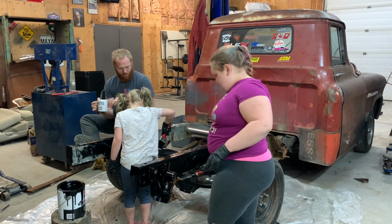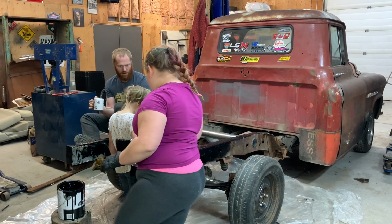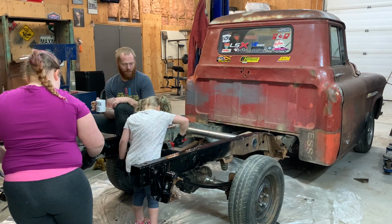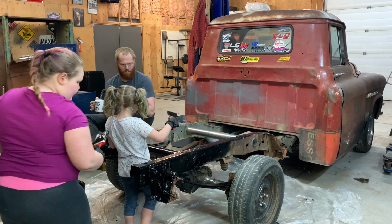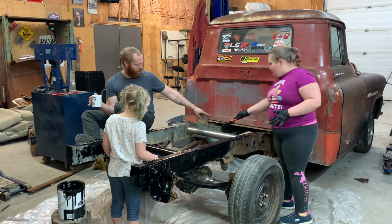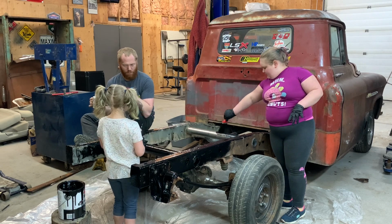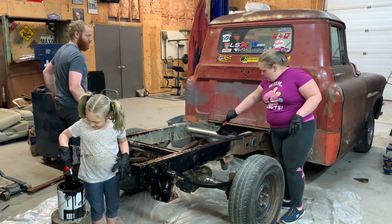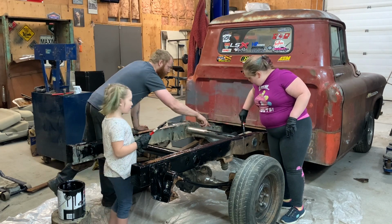This is looking so cool. I'm probably going to have to do another coat on this tomorrow, because you see how it's not quite painting where it's galvanized? Galvanized is a coating that paint doesn't stick to really well. I'm not going to do that part. You can do that part. It's up to you. If you want, I can put you inside of here so you can paint all that too. You see how when you brush it, you can still see.